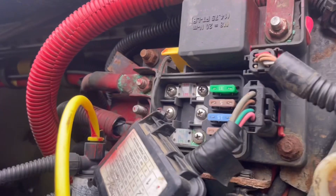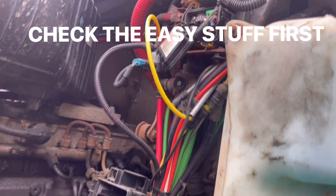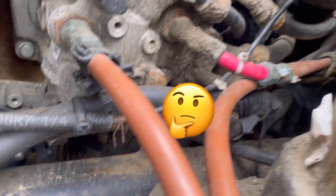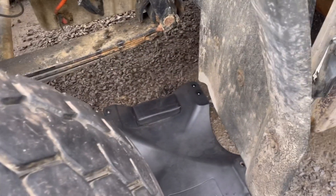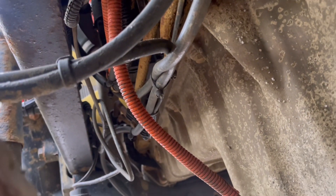We've checked all the powers and fuses. There's a little bit of corrosion back there but nothing that's causing our problem. They like to stuff it in there — there's the motor control module, located up in the frame rail between the engine block and the left side frame rail.